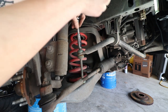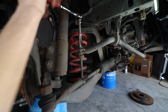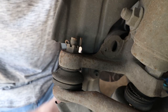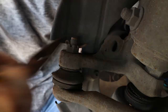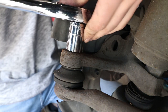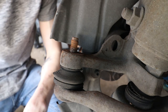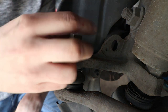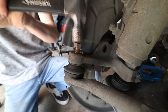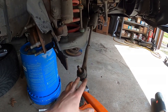This process for this side is completely the same as the other side. We're going to remove the top bushing to the end link on the sway bar — just remove the nut and the bushing should come with it. Now we need to take off this cotter pin holding in the tie rod end. Flip it upside down, make sure the threads are flush with the top, then take a hammer. One hour later — the tie rod end connections are now out on both sides. I had to whack at this for at least five to ten minutes.